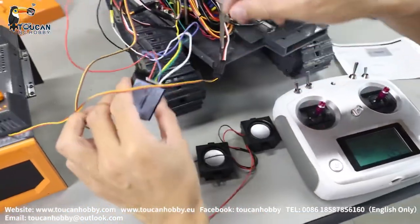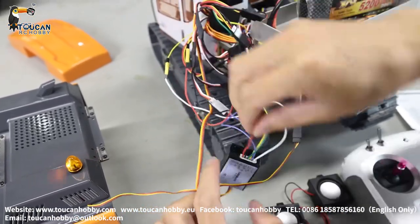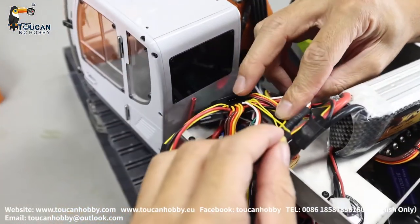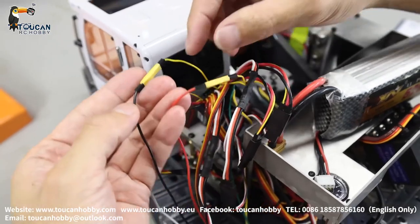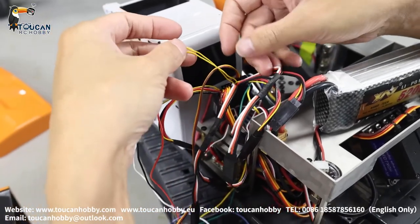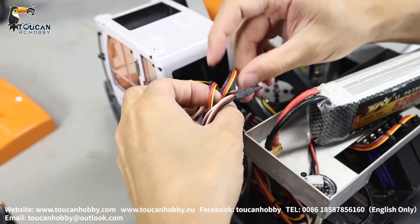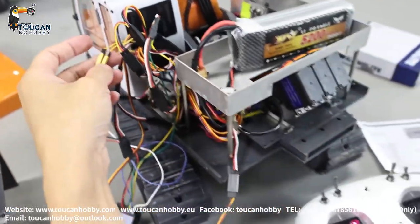Next, the red and black wires — that's for track sound. Black is connected to channel six, and red connects to channel seven. So black and red are for left and right track sound, connected together with jumper wires. Connect together with left track and right track — channel six and channel seven.